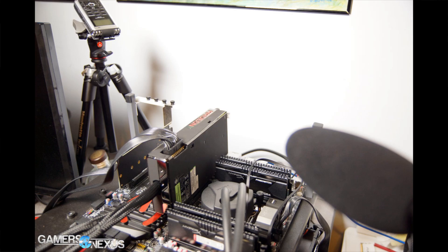We positioned the microphone there for accurate acoustics testing. We used a Roland R05 reporter-class audio recorder for decibel and frequency analysis, and then used an MKE 600 Sennheiser mic — also mounted to this camera — pointed at the video card from a different direction, for directional testing to see whether it's really louder from one direction or another. A third microphone was positioned around the RAM, about 1.75 inches away from the back of the video card, to hear what we can detect that close. As a user you'll never be that close, so that data is not representative or actionable, but it's interesting to test. The mic we're focused on today is the Roland, positioned 11.5 inches away.